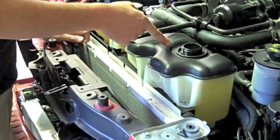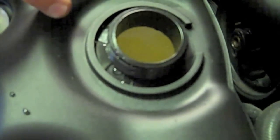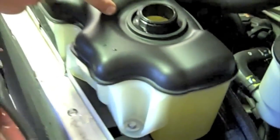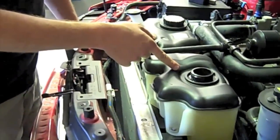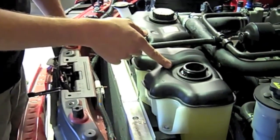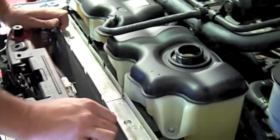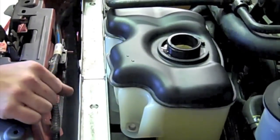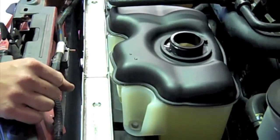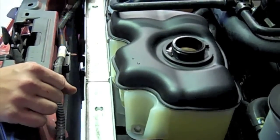You can look inside the intercooler tank and see we've got a pretty good amount of flow going. The new heat exchanger is actually less restrictive, so it increases water flow dramatically, though not too much to cause the water to move too fast. We refilled it with some antifreeze, but we also used a fair amount of water. Water cools best, so it's not necessary to use a lot of antifreeze unless you're in a very cold climate.